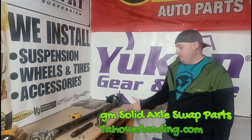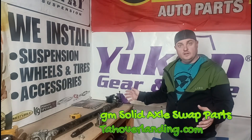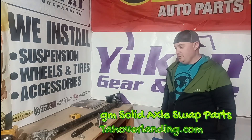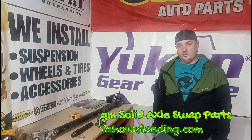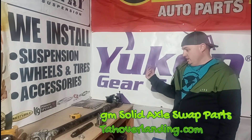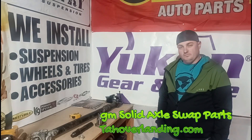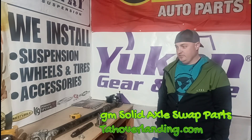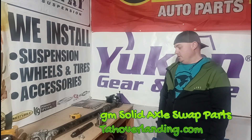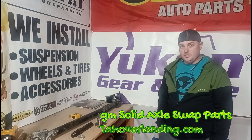If you want a used one, the 2000 Dodge Durango is a good starting point, but there are lots of different vehicles that might have a compatible drive shaft — we haven't measured every used shaft out there, so you may want to hunt around. Don't stress it too much, because if you can't find one, just walk into a drive line shop and say 'build me one' — they'll call you when it's done and you'll put it in your truck.